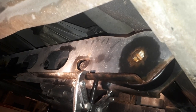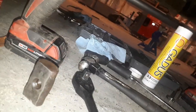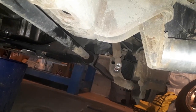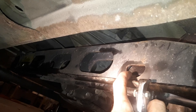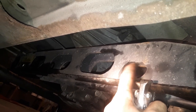And it doesn't give you enough movement on this key to get that keeper in. So you have to unbolt that. See how much that's moving? It's moved almost over half an inch — five-eighths, maybe three-quarters of an inch. I'll put enough torque on it that that keyway will lift up inside of this hole and I can slide that keeper in there.